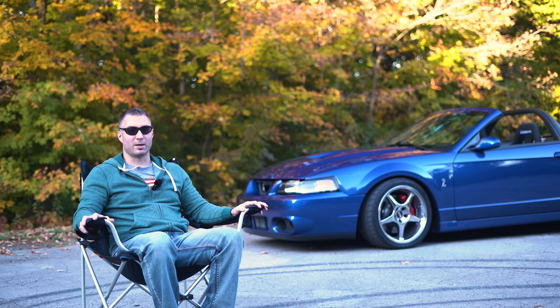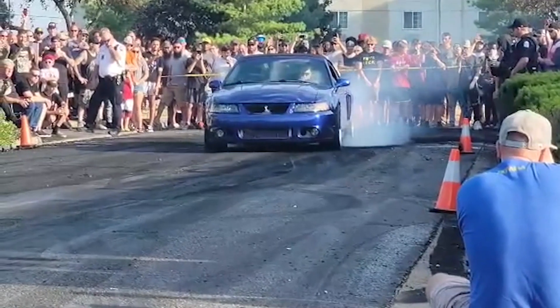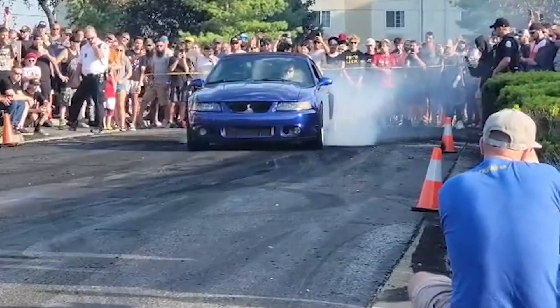Right now I'm rocking the Nation's alternator with the external regulator, and I have not had any problems with that even with a large sound system. Everything is sitting right at 14 volts, so it's been doing me good. I've got all Metco idlers, dual bearing. I do have the Metco two pound and four pound lowers. I have the four pound on it now with the three and a half inch upper, probably pushing about 25 pounds of boost.